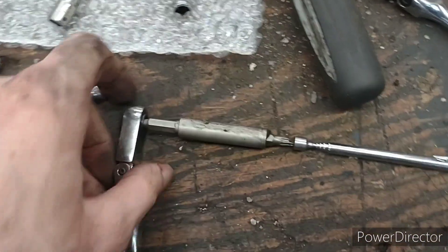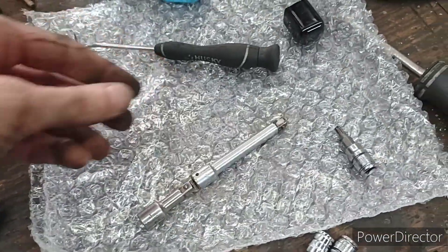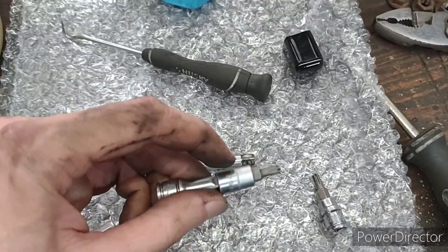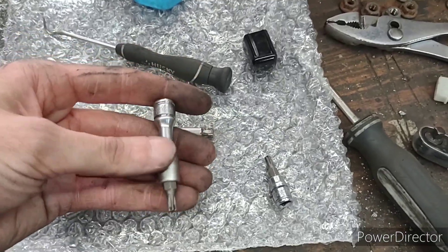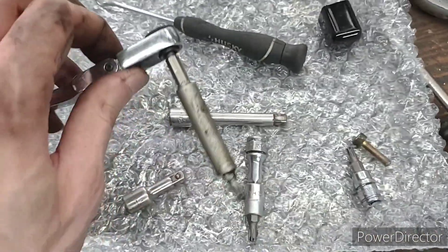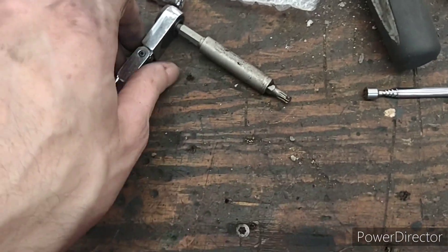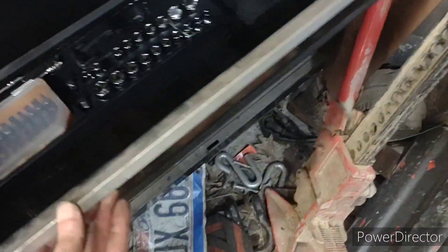This cute little gear wrench I found was the best to use — it's actually just a bit you'd use on the end of an impact driver. I tried a three-inch extension, I had a really short extension on my other T25 quarter-inch socket that was too short, and another that was too long. The body on one socket was too fat, so right next to the pump it just wouldn't reach those little bolts. This one ended up working out perfect — a tad long — and I had this guy here which was a tad too short, so I just made that work.